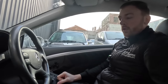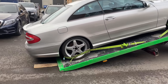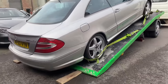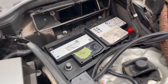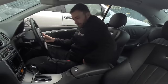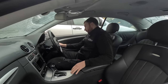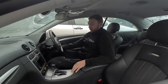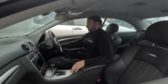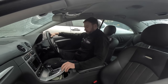You come across all sorts of strange things with a car stood this long. We got it off the recovery wagon a few days ago and the battery was flat. We left it on charge overnight and it wouldn't hold the charge, so we had to fit a new battery before we could do any work at all. We fitted a new battery and we'll see if it starts. We are going to see if it starts - I have a feeling it's not, because when I turn the ignition on I cannot hear a fuel pump priming. So no, it doesn't start. I have to push it in the garage.